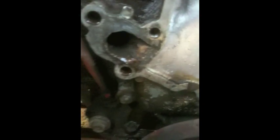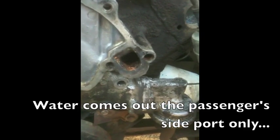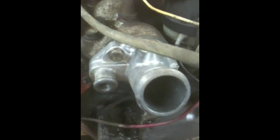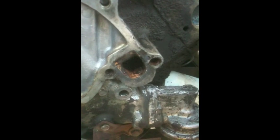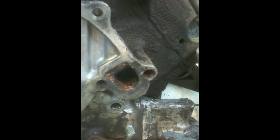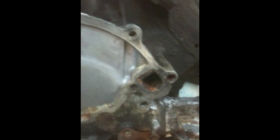When I put water into the system — obviously my thermostat is still in — but when I push water in through the bypass, or if I put it in through the heat system right there in that gizmo, water goes into the system and it comes out the passenger side port only. I can't get it to come out of this driver's side port. The only way I can get water into the engine is over here on the passenger side, but for whatever reason, no water comes out of the driver's side port here at the bottom of the block. So I'm wondering if I have a blockage somewhere back in the block, inside the block, that's keeping water from cooling both sides of the engine — and perhaps that's the source of my overheat: half the engine isn't being cooled.